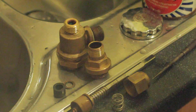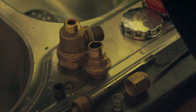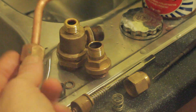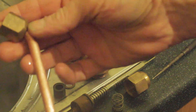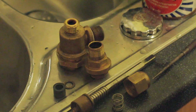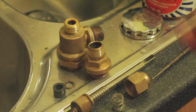I've had a bunch of parts in the citric acid descaler. To show you how the parts come out — you've got the copper pipe and the brass nuts — you can see how it removes a lot of the gunge. That one was actually stuck up out of the tin; it wouldn't fit in because I didn't have a container big enough to submerge it entirely. If you compare that to one that's been fully soaking, you can see the difference. Citric acid descaler is brilliant for cleaning up these parts.